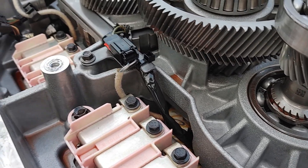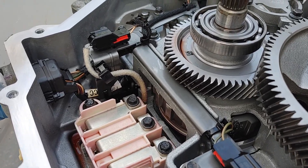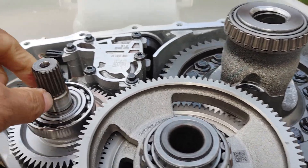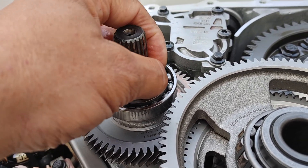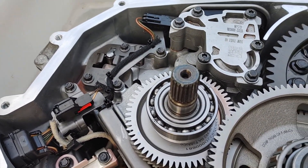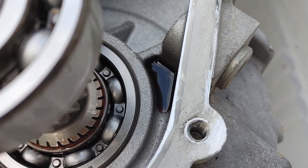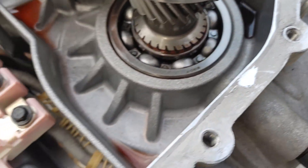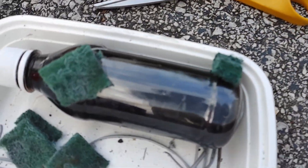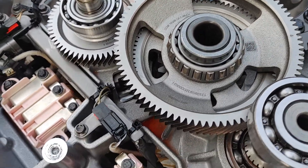My intention is to have this installed in that Lincoln, and I didn't want to waste money having a bad transmission installed. Everything on this one functions properly and it does spin. Looking at the fluid — that color is not because it's dark outside. That color is because it is the original organic fluid; they didn't use synthetic fluid. The organic fluid that came out really concerned me, because there are no clutches or anything inside this transmission to make it dirty like that — only oxidation can do that.